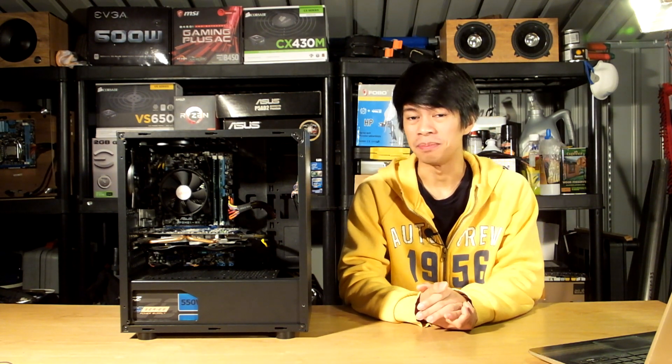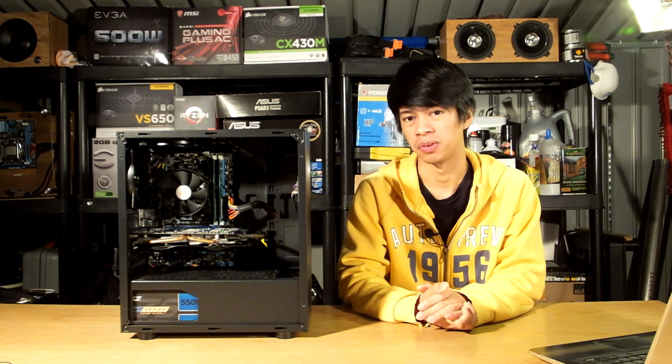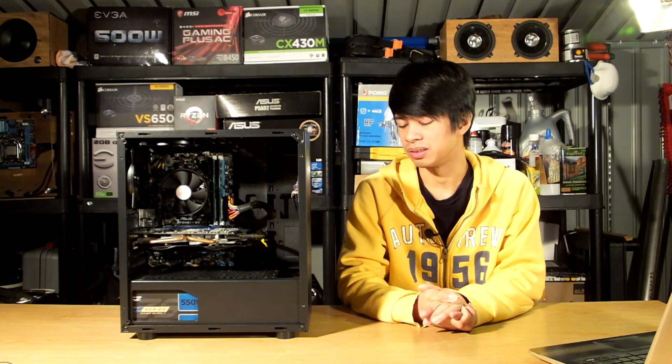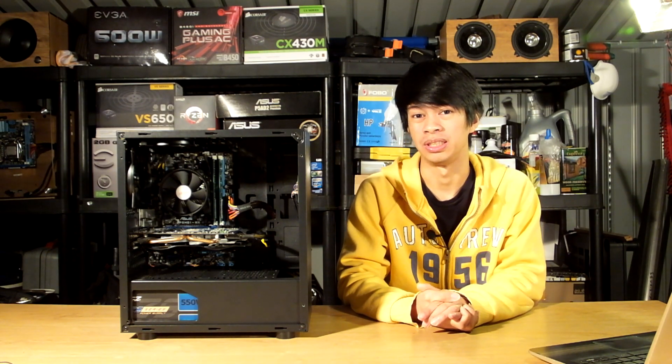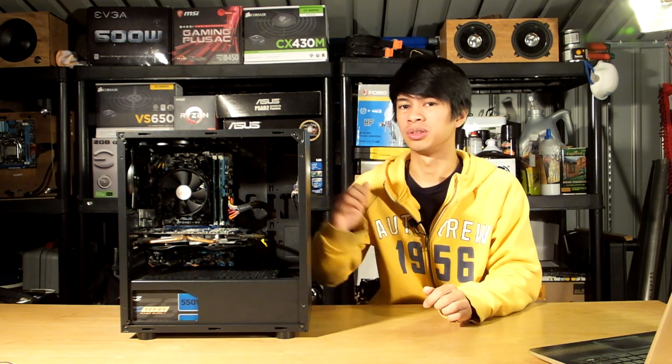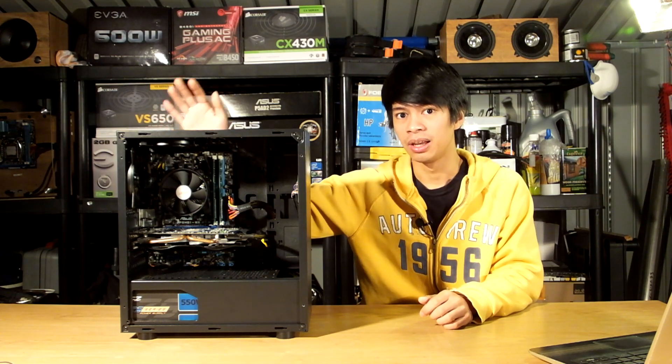So here's my take. If there were more intakes, this would probably be the best micro ATX chassis in the low-budget spectrum, potentially competing with cases up to £40 or even £50. But as is, it's still a pretty good case for being one of the cheapest in the UK with a very nice feature set. At best, you could put in a CPU up to around 77W TDP and a GPU up to 140W TDP before temperatures become an issue. At that point, I don't recommend buying extra fans — just stick to at most two fans, top and rear, as exhaust for a full negative pressure setup.